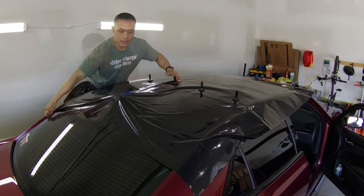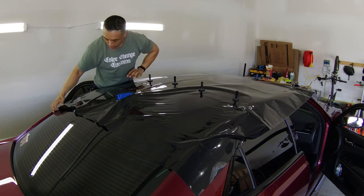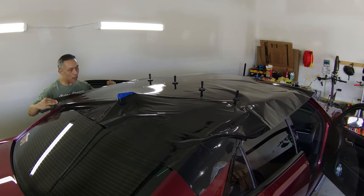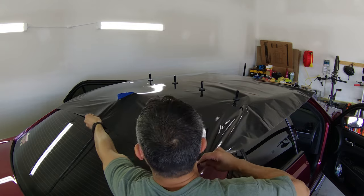I then position the exposed vinyl over the back half of the roof, feeding it over the antenna hole and onto the back window as an anchor. Once you have the vinyl over the back half of the roof and over the antenna hole, make sure you do any adjustments forward or back that you feel are necessary to ensure that as you apply the vinyl around the antenna, you won't have any exposed roof color showing when finished.